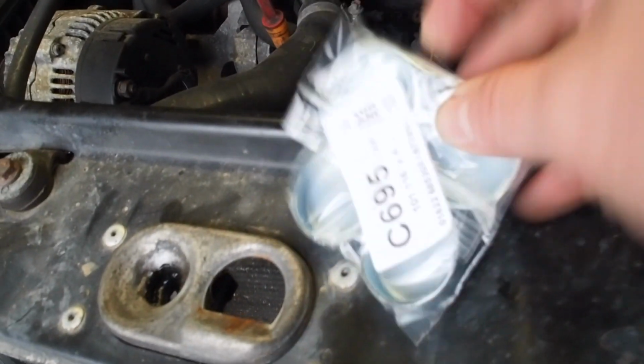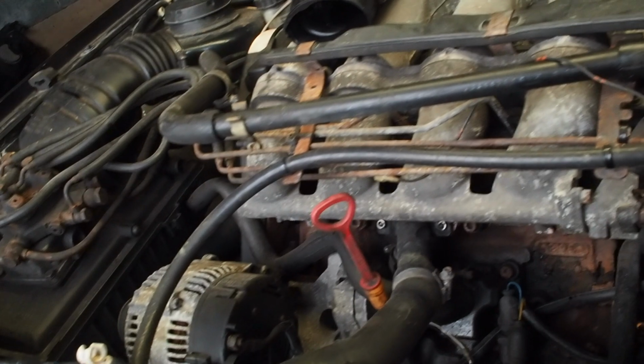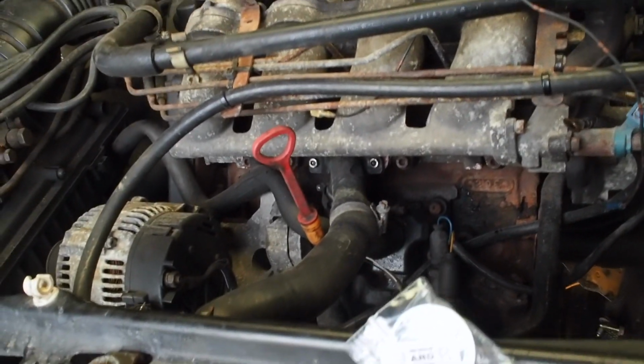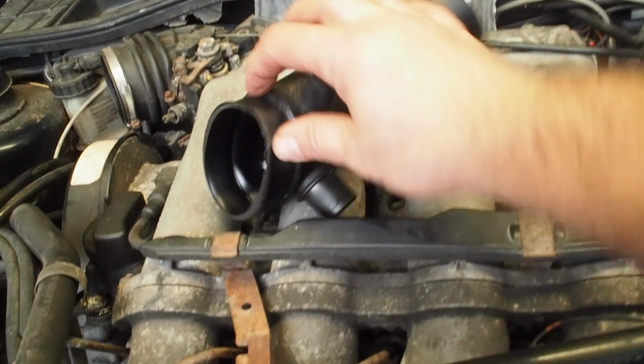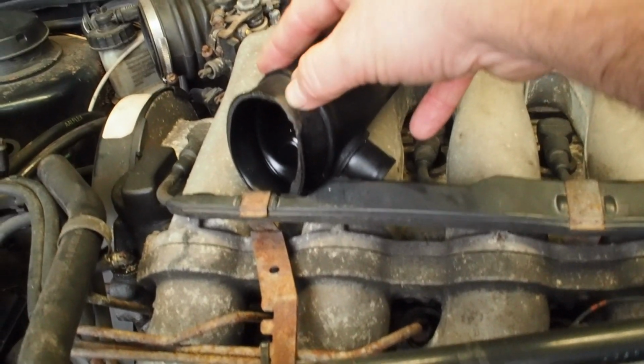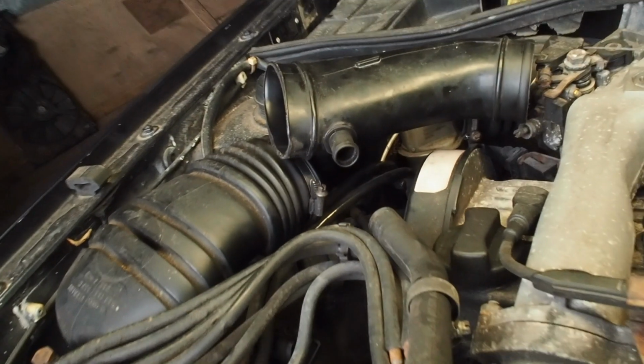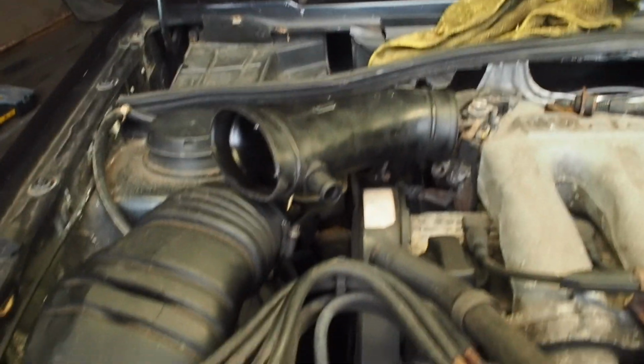That's clean. I've got the core plugs here, so I'm going to replace 2 of these at the back. The third one looks fine, but I'm going to replace 2. I was also able to fix a little kink where someone had obviously over tightened the Jubilee clip on these. You don't have to go nuts with this really. With a hot air gun, I was able to straighten that out, so that stabilizes the idle a lot more, as well as gets full power, because obviously the diaphragm then is being sucked up.